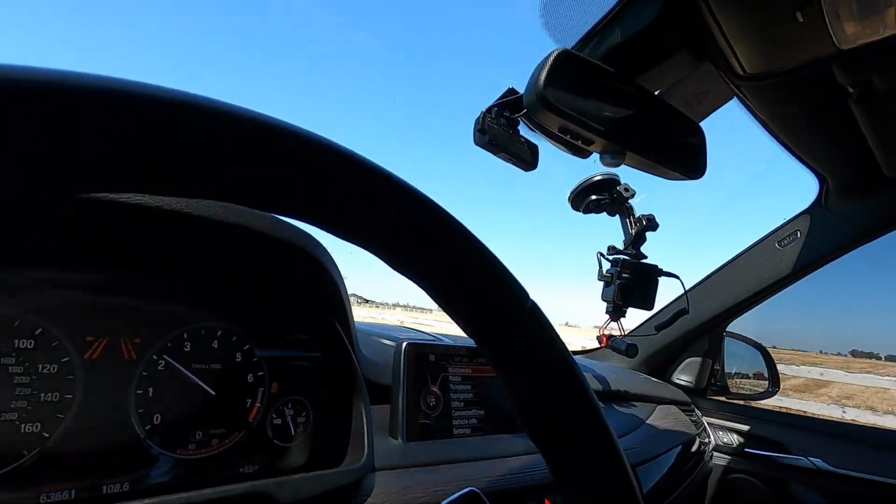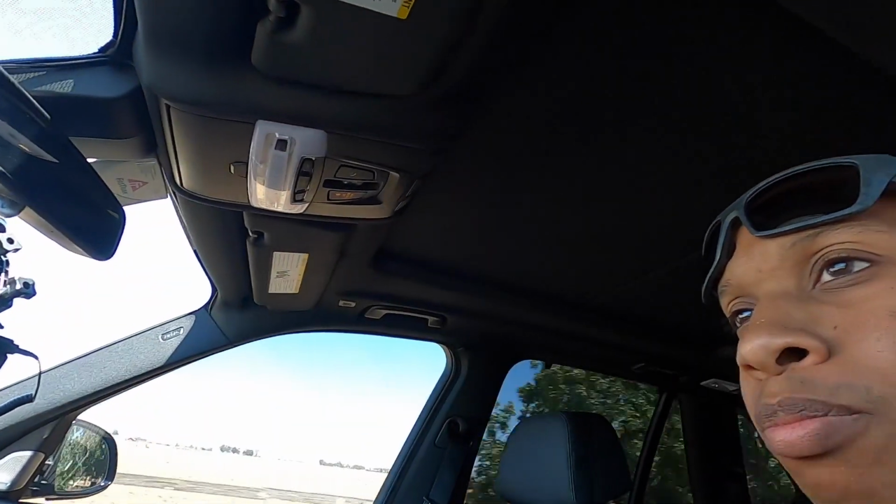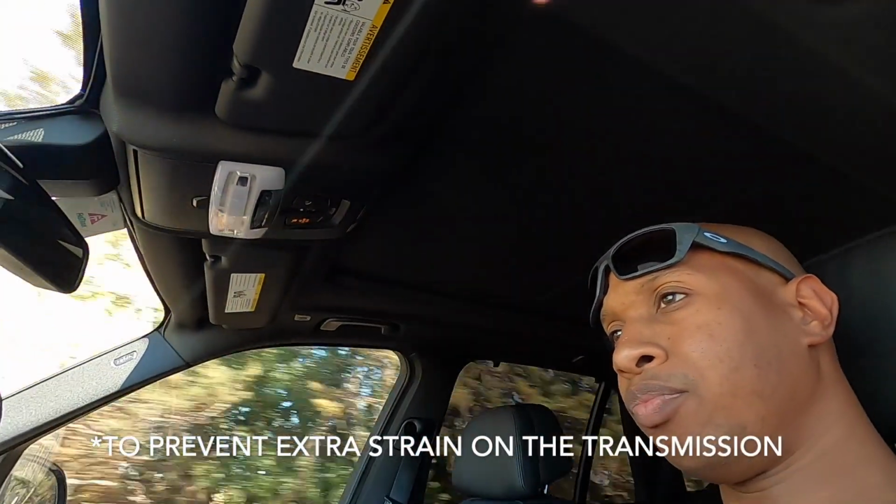So that's launch control. And you saw what I did, warmed it up. Sport Plus, I just put everything in Sport Plus. Transmission in sport mode. Press the brake firmly, mash the gas pedal quickly to the floor, to the kickdown switch, like me, you press it down to the floor and hold it. And immediately you see the launch flag. You have 3 seconds to launch. If you don't launch for 3 seconds, the launch code gets canceled. So you quickly release the brake and it launches out.